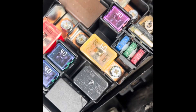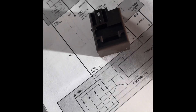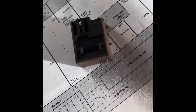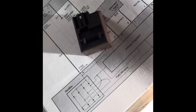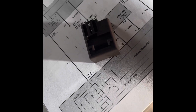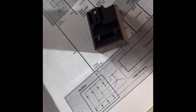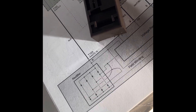Still sometimes my alternator shuts off, and I think it's because of this little piece — that is the Honda ELD. This piece is designed to determine when the car can turn the alternator completely off to save fuel, thus forcing your entire vehicle to run at 12 volts off the battery instead of 14 volts off the alternator like it should.